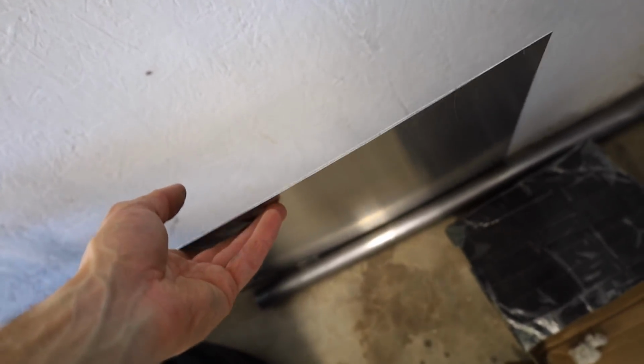My main concern right now is that the dump is gonna be there. So we're gonna be dumping 3 inches right there because we want power, yes, but also we gotta control the heat somehow. So I'm gonna save this sheet for engine bay heat shields because we're gonna have to make a heat shield still around the brake fluid reservoir, like the brake booster. So I'm gonna save that for that.